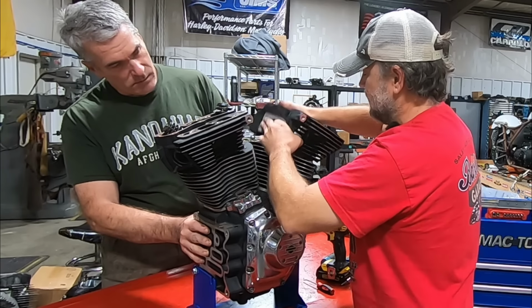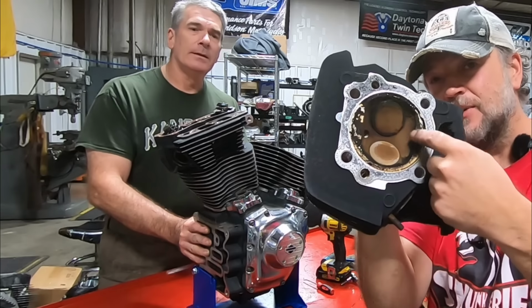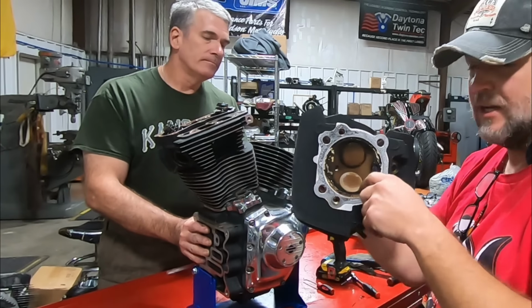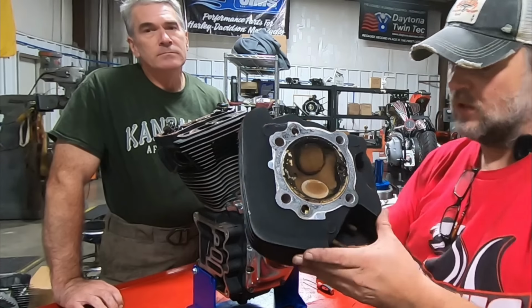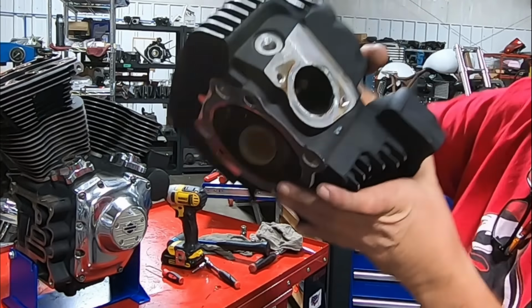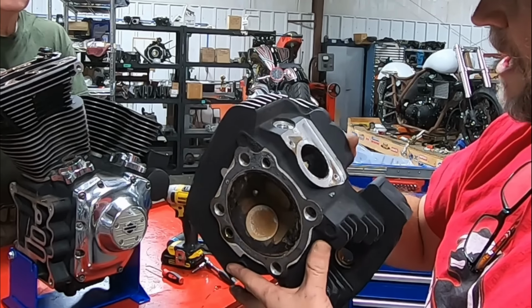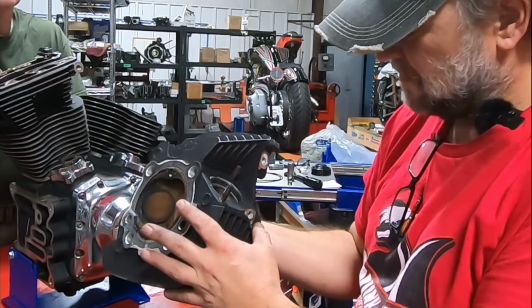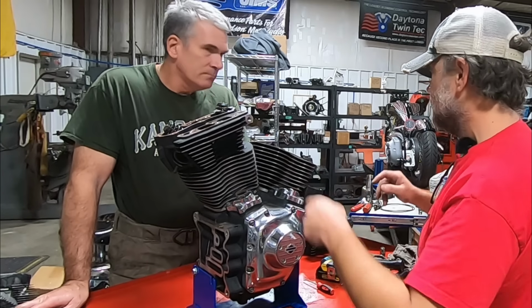And here we go. 3, 2, 1. Holy crap. There it is. Yep. See, guys? See the red color? So I can tell you right now that that's what was going on. That red rusty stuff, just like I said, is octane booster. And I'll go ahead and show you the ports too while we're looking. This thing is just chewed up with carbon. Intake ports right there, it's just a layer. The intake valve is gold. The valve stem is gold. Yeah, we nailed that one. So we can go ahead and put that over there if you like.